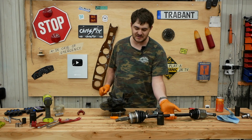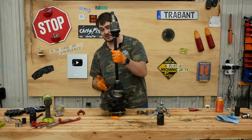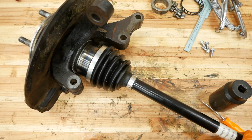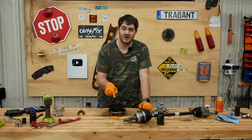On the back side is where the CV shaft fits in, and what's directly in front of the unshielded rollers is the ABS sensor ring on the CV shaft. And that's not going to do diddly squat at keeping dirt out of the bearings and keeping the bearings safe. Now, as I said, I ordered direct replacements for what came out of the car.